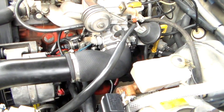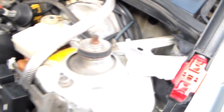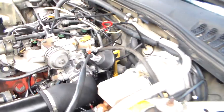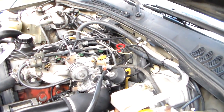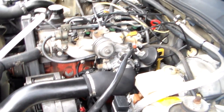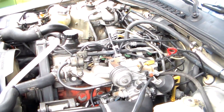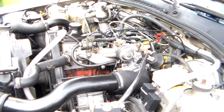This car's got rubber lines all under it, mainly from the factory - kind of crazy, but it's Volvo for you. I was a bit confused between which was the supply line and which was the return. The one I just showed you is the return - it comes off the regulator. The supply line comes from the pump and filter on the bottom of the car and comes up through here, and that's a nylon line which I'm not messing with. Those you basically have to replace the whole thing and it's not easy, so if it's not leaking and doesn't look deteriorated, I'm leaving it alone. Make sure you check your lines on these things for any leakage. Thanks for watching - any questions, feel free to ask.